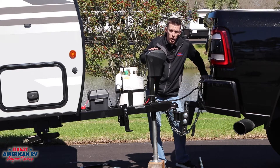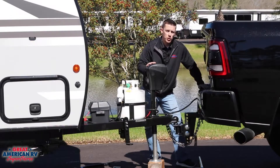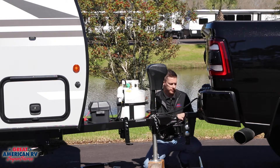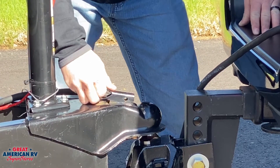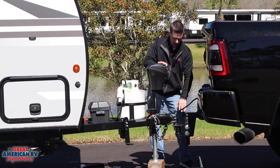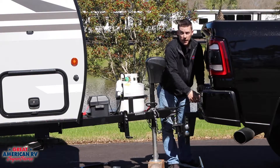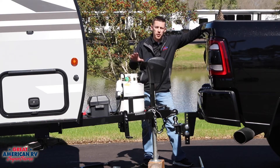We're going to do the same thing on the other side. Once this is complete you can lower your jack down. Once the weight is back on the hitch of the truck you can remove your safety chains and breakaway cable. Next you can disconnect the tongue of your trailer by lifting this latch and pushing back. From there extend your jack and get the coupling off of the ball of your trailer. Then disconnect your seven-way, make sure everything else is clear, and you can remove your truck from your trailer.